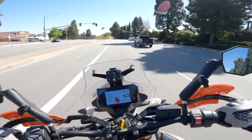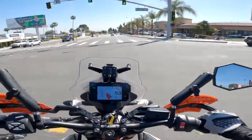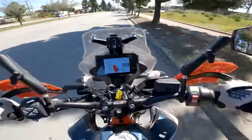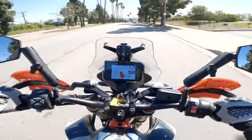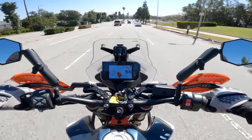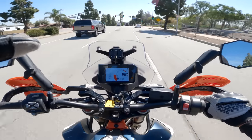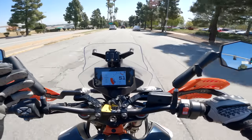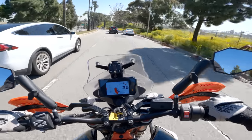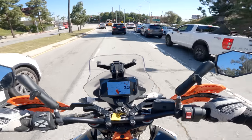Let's talk about brakes — we keep hitting green lights. First, let's hit our little pavement jump. Terrific — this bike could hit a jump four times that size at that speed and be totally fine. The suspension is very good. The separate damping circuits mean the top of the stroke is really controlled. When you land off a jump it starts soaking up the bump early in the suspension travel, leaving the rest for rider control. There's a difference between stiff suspension and harsh suspension — this is stiff but extremely well controlled. A real treat to hit jumps on.